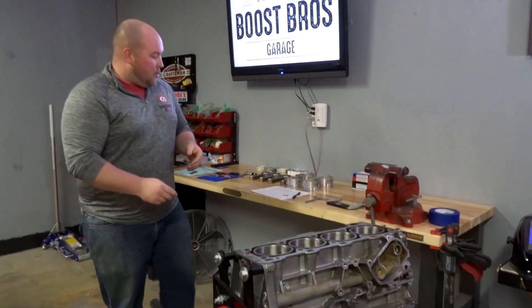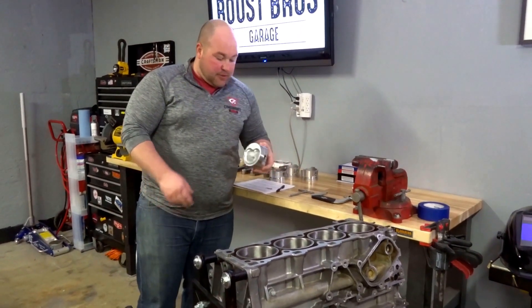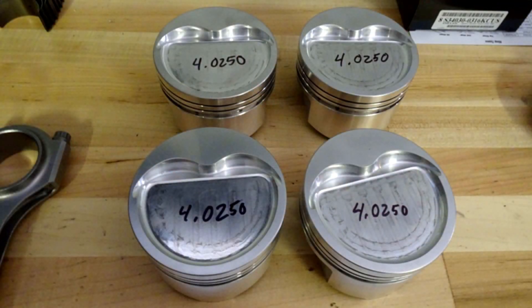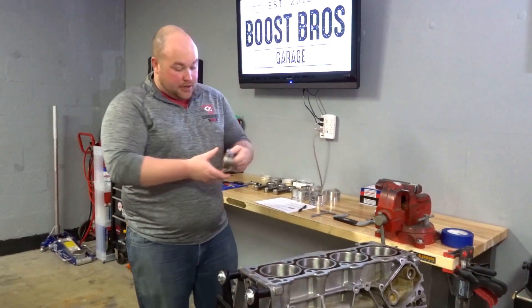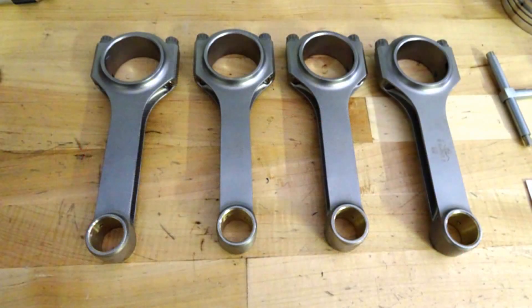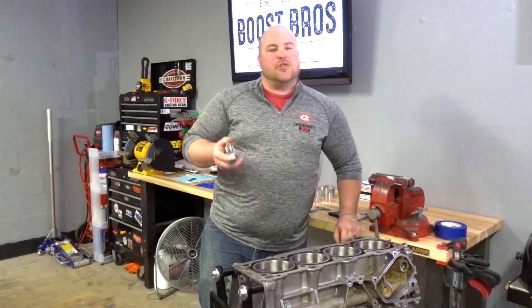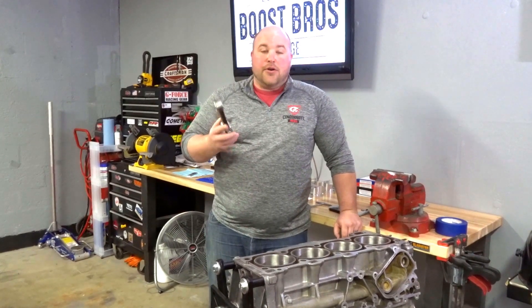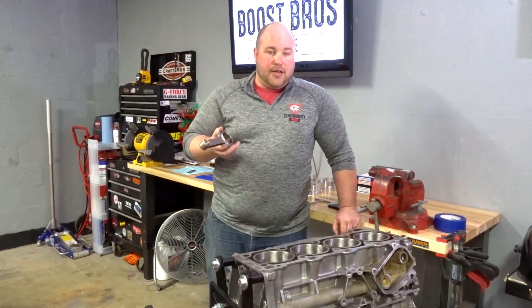The internals of this motor are a little bit odd and that's the reason it's called a hybrid stroker. To do this hybrid stroker you're actually using pistons from a small block Chevy — these are 4030 pistons, so it's a 30 over bore from a standard small block Chevy. On top of that we're also using the rods from a Mitsubishi 4G63 motor, which I believe is for the Eclipse. These pistons and rods, along with offset grinding the crankshaft, increase the displacement from 2.5 to 2.85 liters. You're also using off-the-shelf parts instead of custom-made stuff, so it's more cost effective and easier to get — it's a win-win.